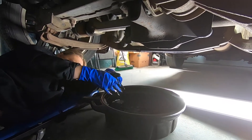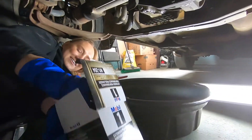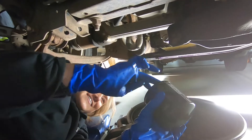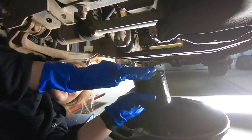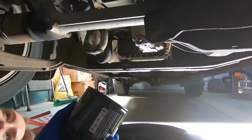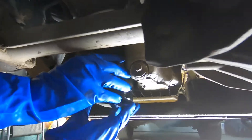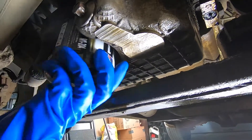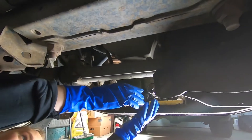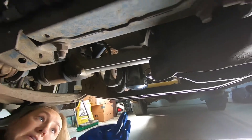I'm just gonna take these off. How about I'll just be a nice apprentice and I'll get you your new filter and paper towel. Got those hands cleaned up — now what are you doing? Putting the new filter back there. Is there anything you gotta do before you put it on? Lube her up. Get that o-ring lubed up. Make sure you don't get any debris in it. Get her on there — make sure you don't cross thread it. Just hand tight. Like as tight as I can get it? Yeah, I can grab her after and just snug her up.